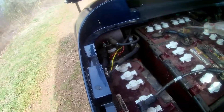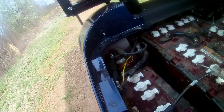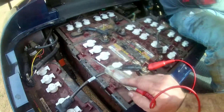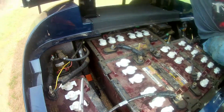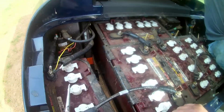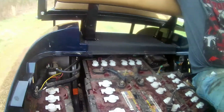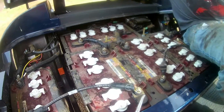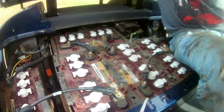Each battery is doing that all the way across. So we're losing initially 3 volts per battery. And this being a 72 volt system, that's bringing it down to where its run time is basically nothing. So we'll get the batteries replaced in this golf cart and it'll be like brand new all over again, and they'll stop running into that run time problem.